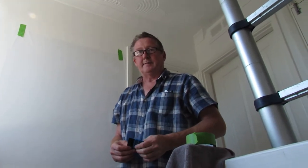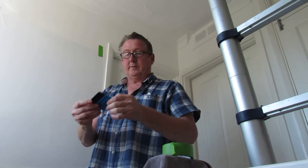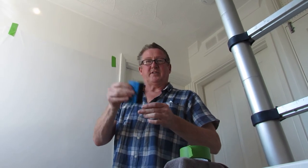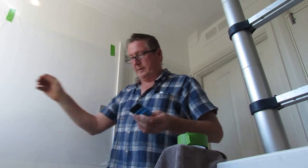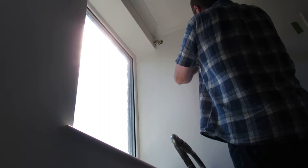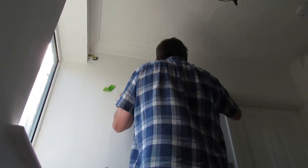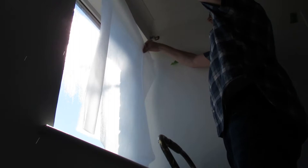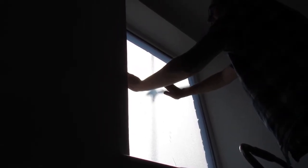If you've never put this stuff on before, it's applied differently to what you think. These are normally put on — I think they're called PA1 — it's a 3M squeegee. That's what they use for signage. It does help — it gets rid of all the water. You can use a credit card or even a Tesco Club card, but with these squeegees they have a nice felt edge so you don't end up damaging anything. I'm removing the tape — I've cut this oversize so I'm placing this side on the window. I can move it around with the water and trim the other side off.